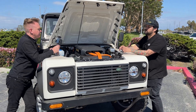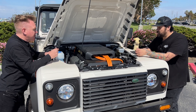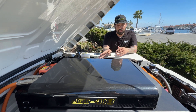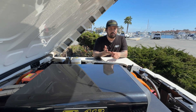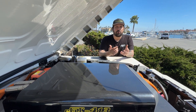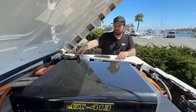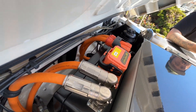Since we design everything, we manage the cooling system, VCU, and BMS. We're running an AEM BMS and an AEM VCU for the system. Everything is controlled through the computer via AEM Cal. With it we're able to see all the individual cells, all information, and any faults that may be occurring with the system so we can attend to any problems.